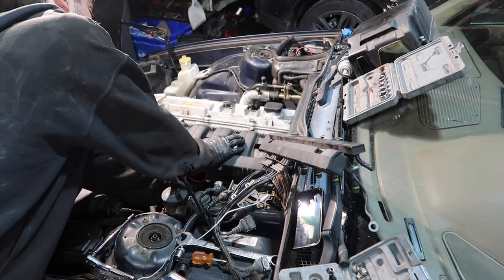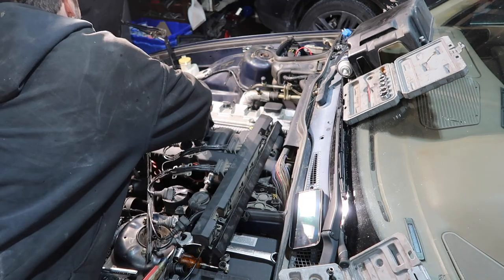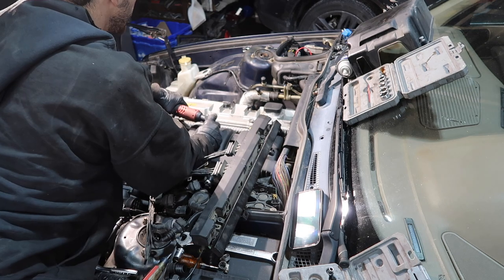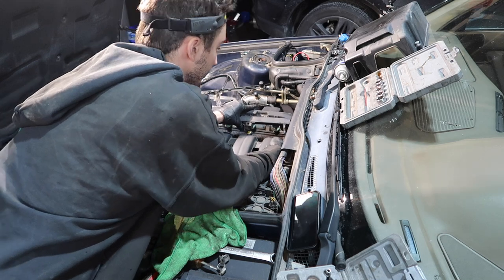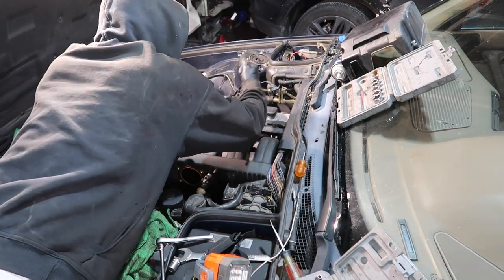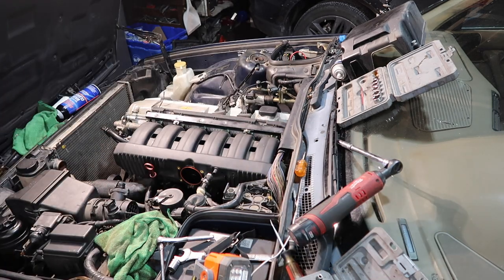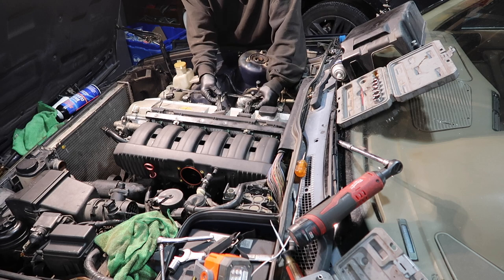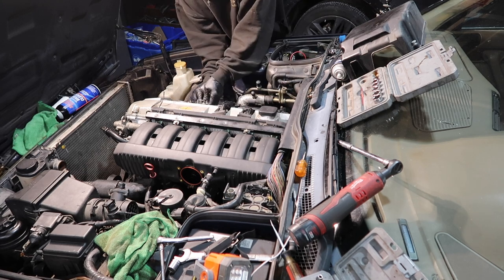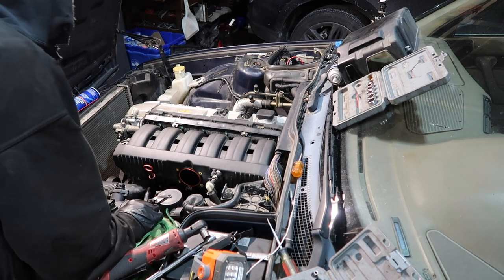A little ICV elbow is popped into place. You can kind of hear it when it goes. Trying to get the injectors and the rail in place. Now we can lay in the coil pack wiring. Throttle body time. Oh man, this is exciting.